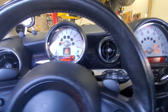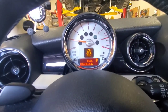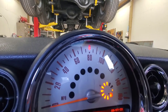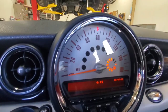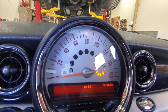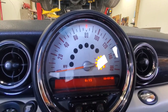The airbag light went off — that's good. I've got a headlight or a lamp out, I know that, that'll go off in just a second. I don't know why the seatbelt light is still on. It does say that if it gives you a certain code on the seat belt, you can remove those two wires we just put in — the red and the black — and there's another little resistor you can put in line there to take care of that. For right now I'm going to leave it like it is and see if it dings at me. At least we've solved the weight sensor issue, so we're going to go with that and see what happens.